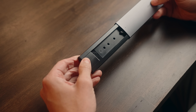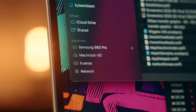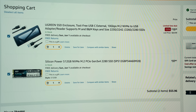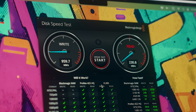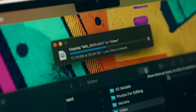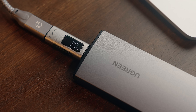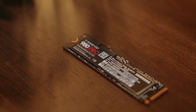Now beyond those portable drives, NVMe enclosures are kind of a neat option. Those take M.2 2280 internal drives that you would normally stick in a PC and turn them into portable storage. Enclosures around that same 1000 megabyte speed are super inexpensive — this Ugreen one that I have here costs less than 20 bucks, and combined with a sub-50 dollar NVMe internal drive, you'll get a cheaper solution that will outperform both of those portable drives, and you can swap drives as needed. That said, there's no real improvement in drive speeds — you might see an extra 100 or 200 megabytes per second in tests, but real-world use will feel largely the same. There are also some negatives like potentially higher power draw and compatibility issues with SSD models, so it's worth doing some research on what the most successful drive combos are.